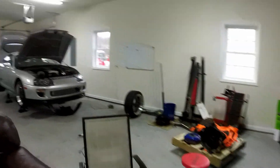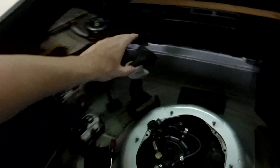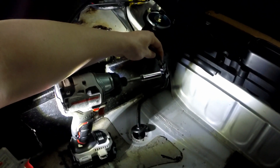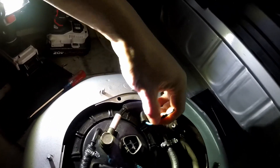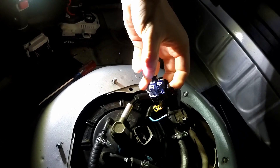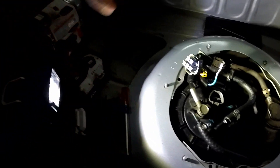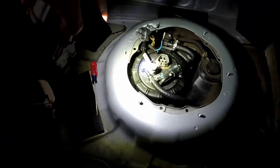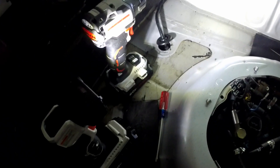I'm going to walk back to the back of the car because I de-pinned the wrong wire — I'm an idiot. I was de-pinning the red and blue wire over here, but what I needed to do was de-pin this blue wire right here. The kit is actually plugging directly into this because the wire isn't thick enough and Jose didn't want to risk burning it out. So to make it even better I'm going to pin it directly into the fuel pump itself. It's a little frustrating because now I have to feed the wire through that little grommet.